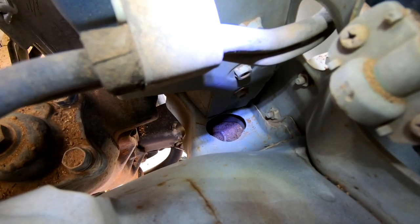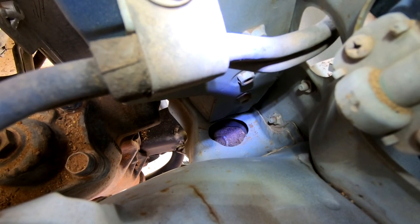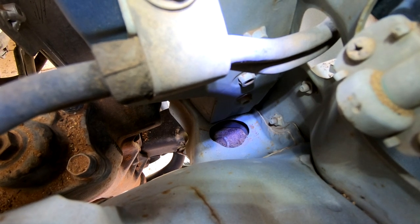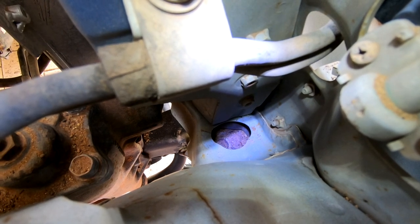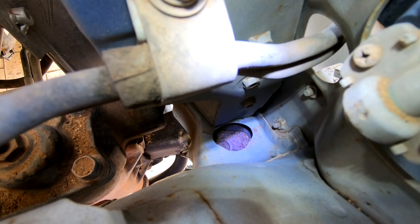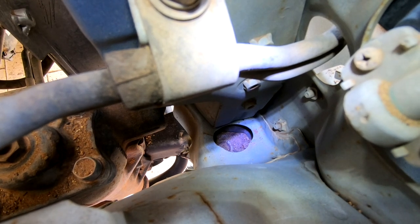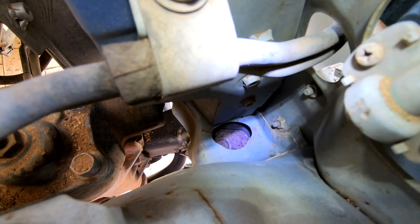The bolts in there have like a little bracket coming off the side — they're not a normal bolt as such, they'll turn so far and then wedge up against the body to either tighten or untighten. They're very easy to undo when removing, but when we change that for a new bolt during the body lift we need to get some kind of socket in there to hold it while we're tightening up. Taking it out is easy; putting it all back together is a bit more tricky.